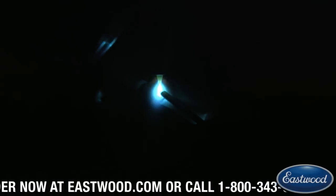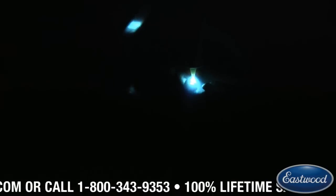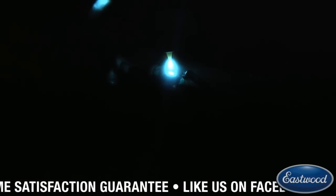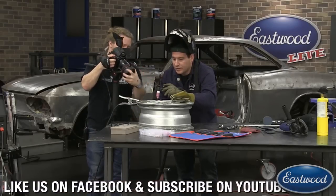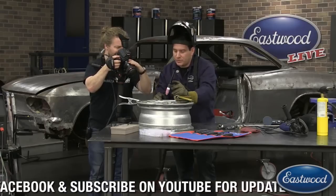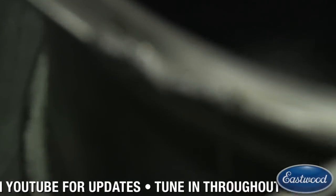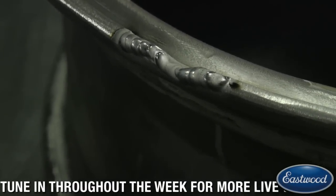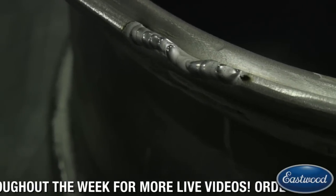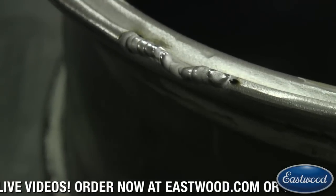I'm just adding a little bit. You can see I got a little bit of let-off. I didn't want to go too much further here — I had a little bit of black contaminant that was starting to pop up as I went out because I didn't run the torch over it to let it clean all the way out into that area. I started to see some black in there, so I didn't want to go too much further so we don't get contaminants.